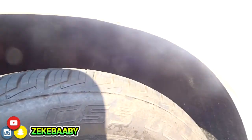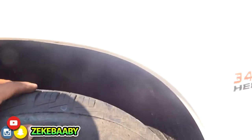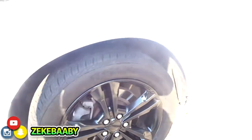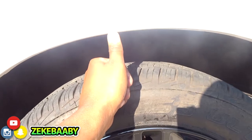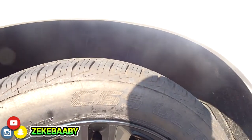I wish I could drop it, bruh, but I really can't. They was telling me about the CV axles — if you drop it too low, the CV axles gonna bust and you gotta keep replacing them. Cause I was gonna drop it probably like an inch and a half. I could get the RT springs like everybody was telling me — just get the RT springs and they ain't gonna do no damage. The regular rear wheel drive RT springs, they ain't gonna drop it but an inch though. So I don't know, I might end up doing that eventually cause I don't like how tall it looks, bruh. Way too high for me.